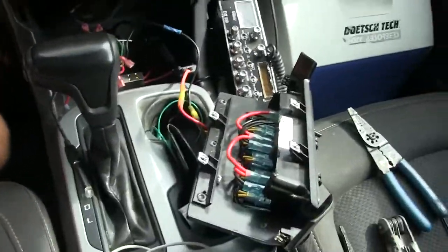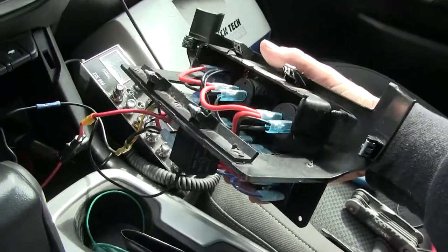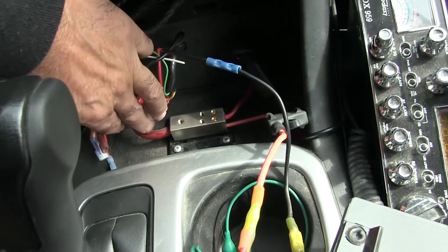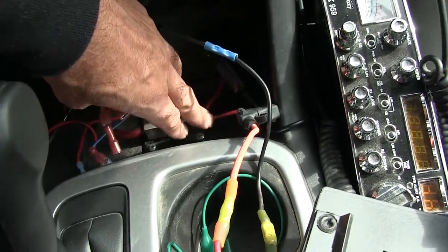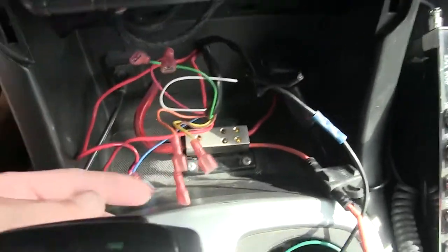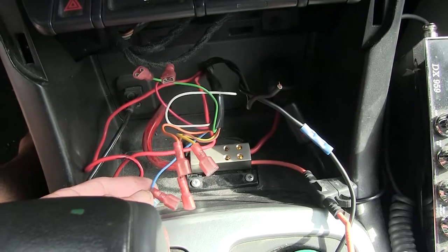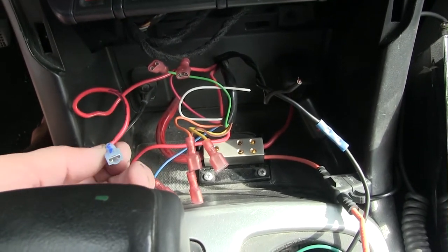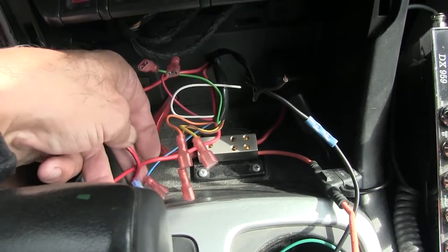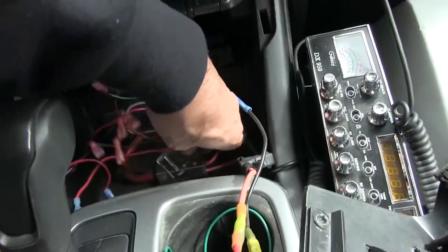All right, ready to put this thing in — got it all done. I know it looks complicated, but the majority of everything is wired here. I just had to tap in a ground and a power. Here's my power coming off my battery — I got a four-gauge coming in, it's got four extra taps on there. I got one for the switch, this one goes to my CB radio, and I got extras there just in case. I had to reconfigure this a little bit and identify all these wires — each one controls something, color-coded. They go back to the camper shell. These two red wires are the fog light and the LED bar on the bumper, going to the front of the truck. These little wires are just control wires for the relays on the shell.